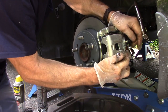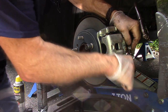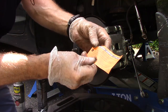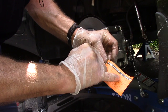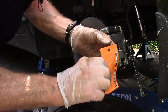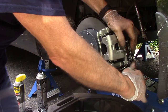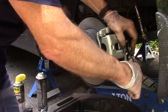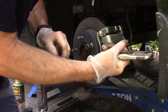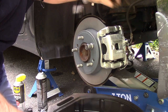Make sure that little tab is connected into that small hole where it's supposed to be, and now we can snug this down. Remember what the paper said — soft aluminum, do not cross-thread or over-tighten as damaged threads void the warranty. Snug it down just till it touches and then just a little bit more. Now we can remove our vice grips that were on there. That's it.